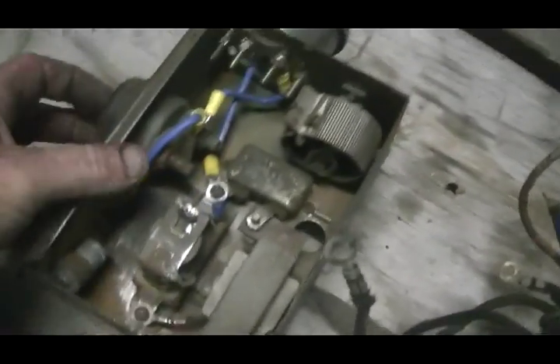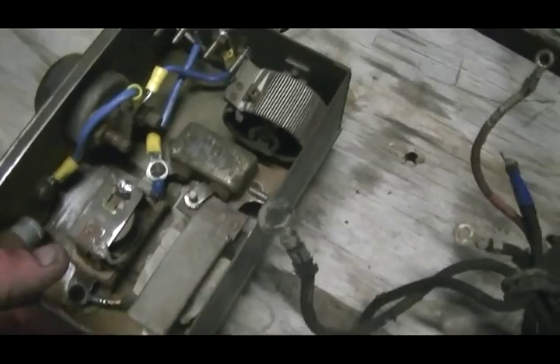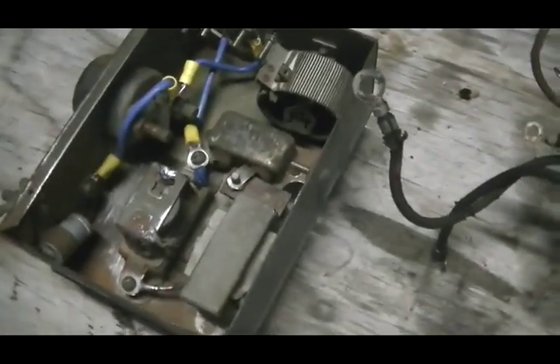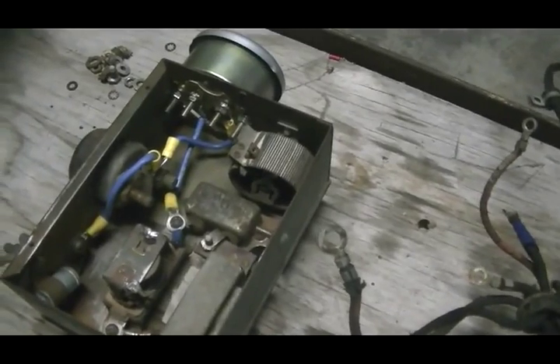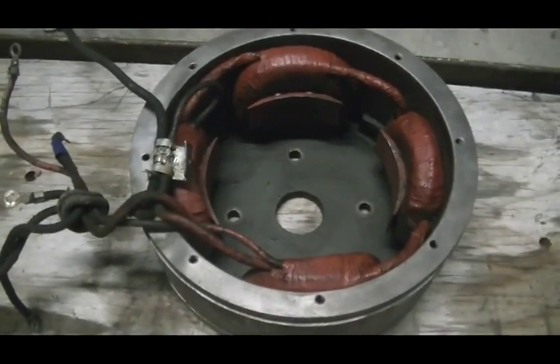So that's where we're at. I'm after some suggestions. This box is all ready to go. The switch is now good — I took that apart and cleaned the contacts. The pot's all good. This condenser checks out okay, and so do these two. One actually had a broken lead on it which I have to solder a new one on — no problem. So far we're all cleaned up, ready to put it back together without an engine or anything to put it on. Chuck your thoughts my way, guys, and we'll see what we come up with. Cheers.